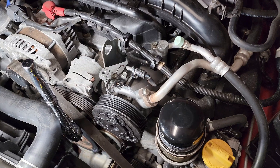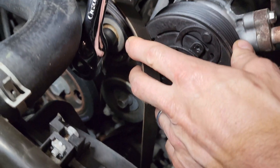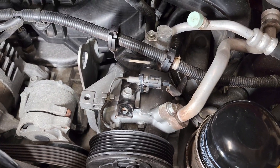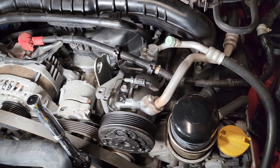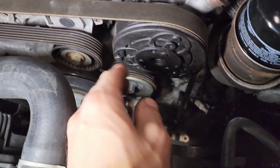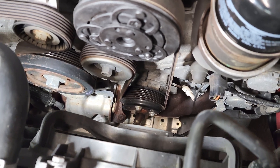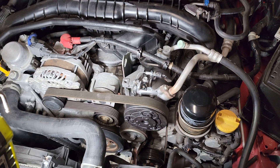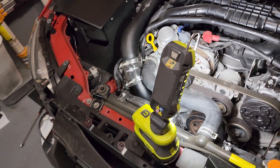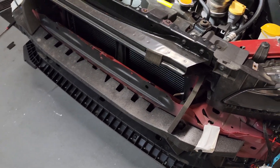The new compressor is in. Now I'm going to ratchet this 14mm pulley to give me slack so I can mount the belt to the new compressor. I wish I had bought a new belt ahead of time, but it's easy enough to replace later. The belt is back on — just make sure you're hitting the grooves everywhere, especially down below where it's easy to miss. At this point I'm ready to put on my belt cover and the Process West piece. I'll add my snorkel and start reassembling the bumper and the underneath splash mud guard.